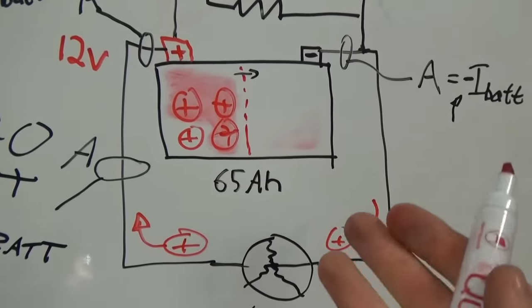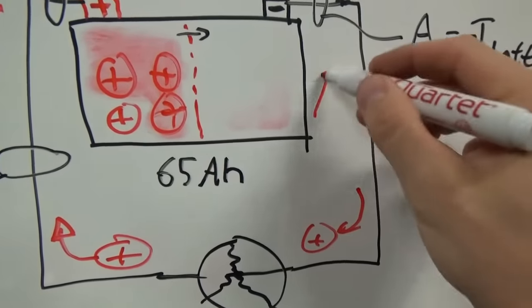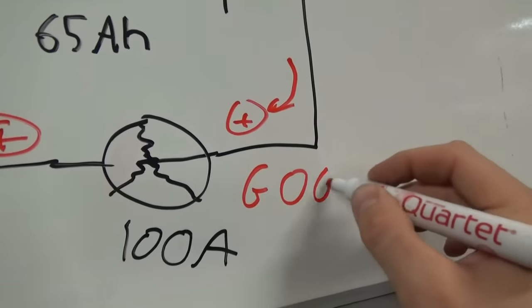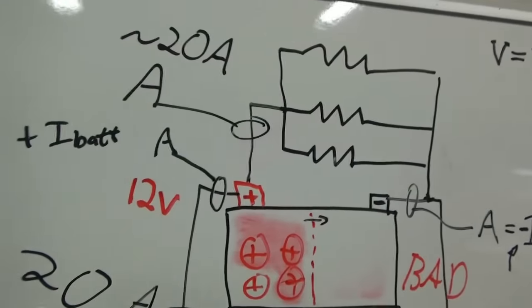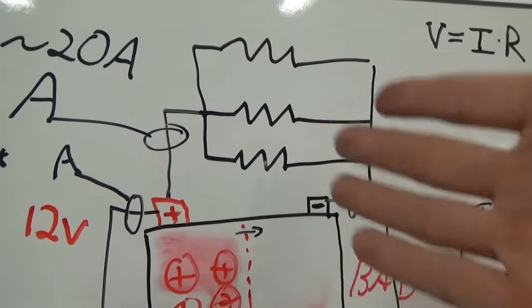Literally, this test takes two minutes. So the battery: bad. Alternator: so far, good — it kept the voltage up to 15 volts with lights and loads on. Not worried about the alternator at this point. We definitely have a bad battery. We already kind of did a parasitic draw test — is something staying awake draining this battery overnight? I don't think so. However, we have to be 100%. We don't want to just put a battery in this thing and then — what if there's a parasitic draw? He leaves it for a week, comes back to a bad battery, or the battery gets damaged by being drawn down all the way.